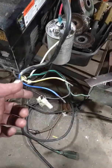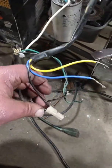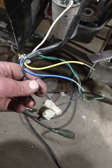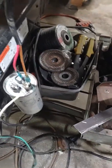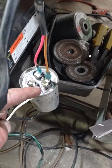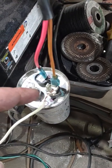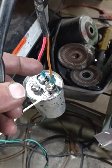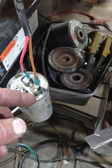If you want high speed, which I have it wired for right now, you hook your hot coming from the wall to the black. Then, what I didn't do before: you take your neutral coming from the wall and hook it to the same terminal — there are four terminals on this capacitor — or you wire it right into your brown, and then hook your brown to the capacitor.